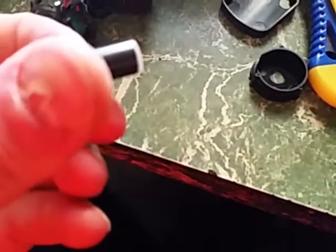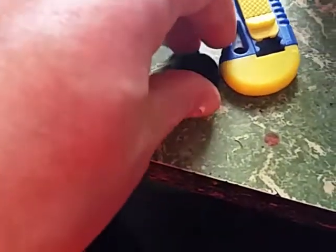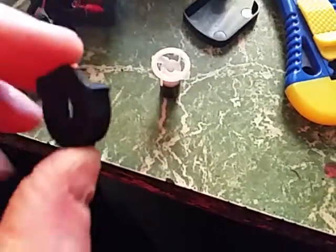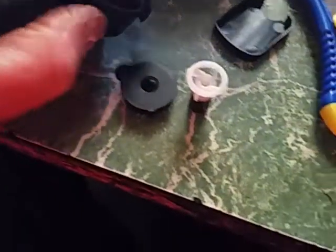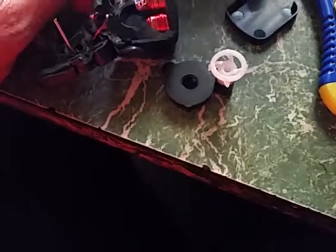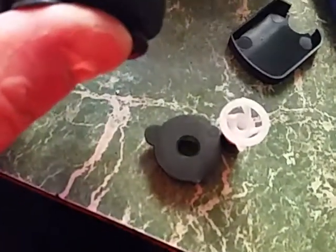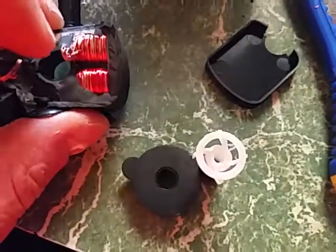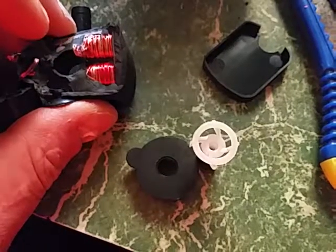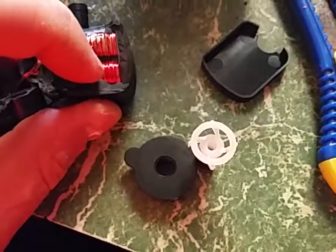There's oil on it — you can see it, though not with this crappy camera. That little piece goes over the top for your intake, and that slot there is where your outtake goes up into this assembly — it all goes inside there. All they've really got is just a magnet that sits in there spinning on that piece of wire next to these coils here. It's wire like you'd find on the back of old-style TV screens — those coils — really thin with a red coating.